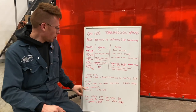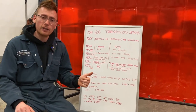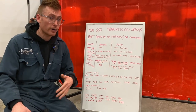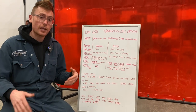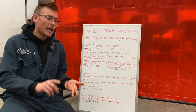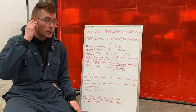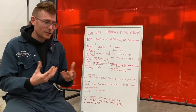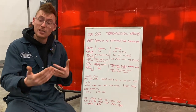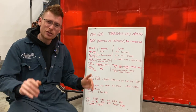One of the main issues is that lots of people shout the benefits of the 722.6, but people are buying them or getting them free with 606s that have done 200,000 to 300,000 miles. These things are already worn out. They have conductor plate issues anyway — that's a standard failure on a 722.6. The aftermarket controllers don't gel nicely with a mechanical pump. The combination of all those things is a problem. The length of the box is good and you can get it into most applications cheaply, but the amount of headache it causes — I wouldn't touch one with a barge pole.